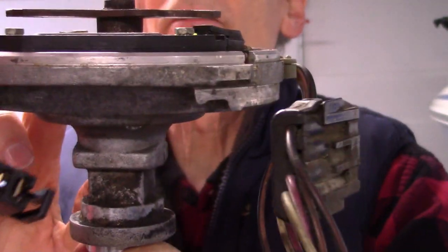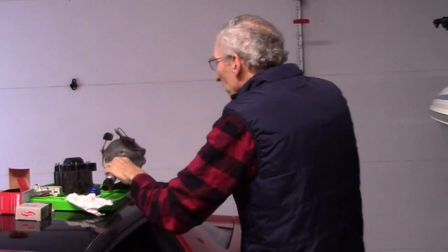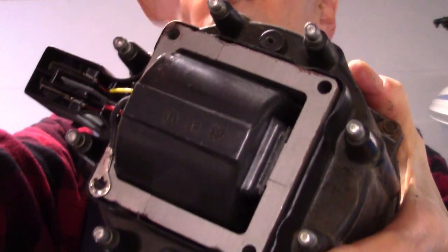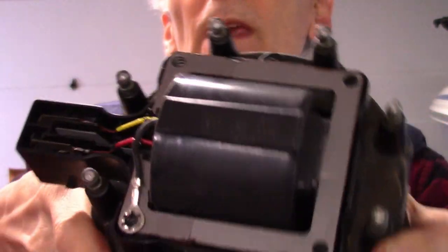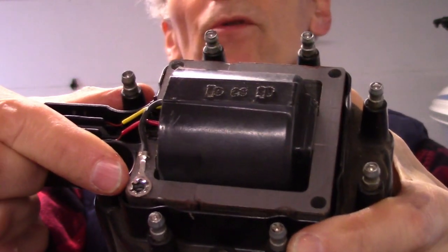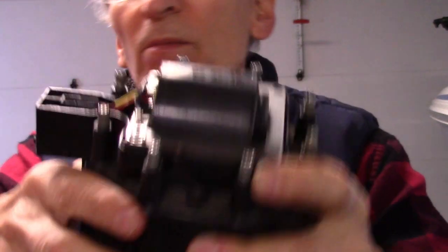I replaced all those parts so everything was brand new. Then you put the gear back on and drive that roll pin back in. That's really the prep. I also replaced the coil on the first go around. This is the old cap and the old coil — it's not hard to replace. There are just four screws around the outside and connections that drop down into the cap. The new coil and cap didn't come with screws, so I took the cover off the old one, took the screws out, and moved them into the new one.